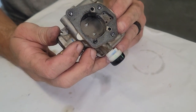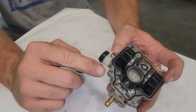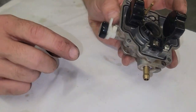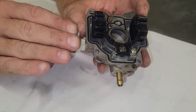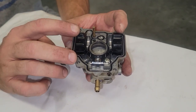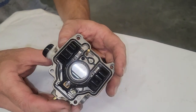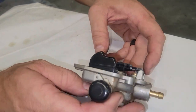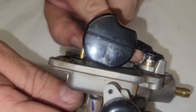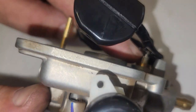These needles are a little harder to check because the end of the needle has got a spring inside of it. The older style, you could actually watch where your float stops. You'll know that you've got the float height set correctly. Right now, this one just bottoms out on the body below, but I can tell it starts pushing. I don't know, maybe Joni can see right in here. You see that little stand in there, Joni? It's like a little peg. Where the needle is, kind of where my fingernail's pointing.